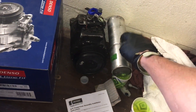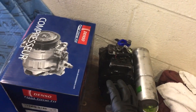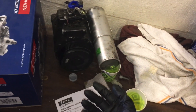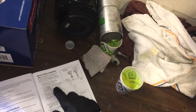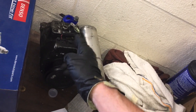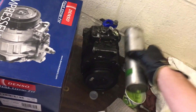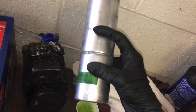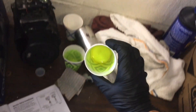I had them replace the receiver dryer, but I know the evaporator is filled with oil. I didn't want to add too much — an empty compressor came out and if the technician didn't know any better, he'd see no oil came out and the instructions say to put a certain amount back in, which would have over-oiled the system. But I know where the oil is: it didn't leak out, it's all in the evaporator. So this car already has the whole system oil charge minus the tiny amount stuck in the desiccant and filter material of the old dryer — just a couple of drops came out of there.